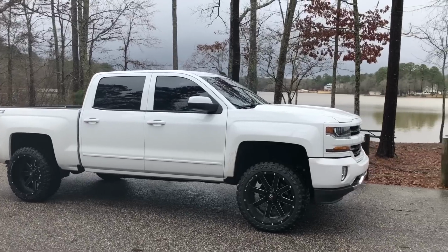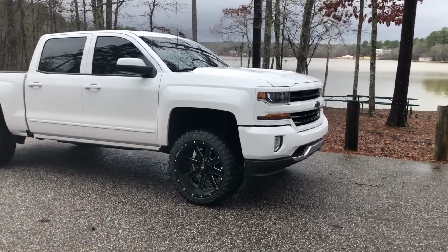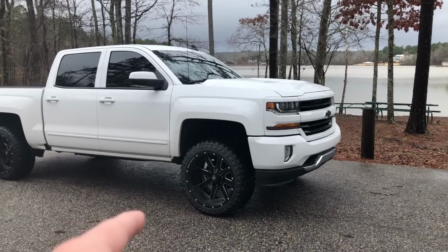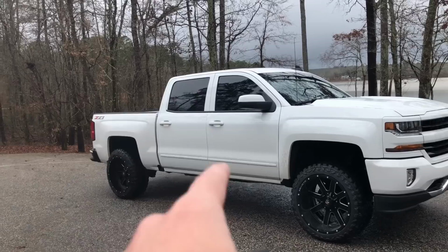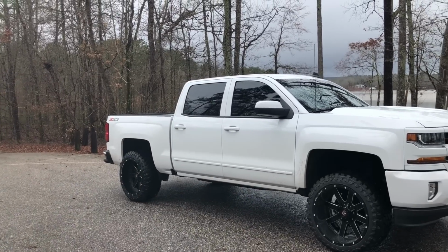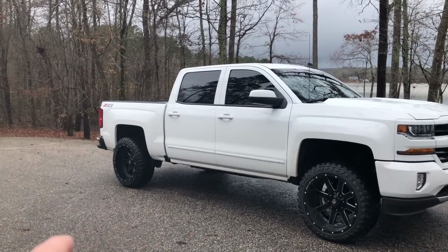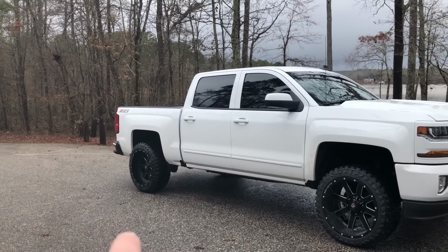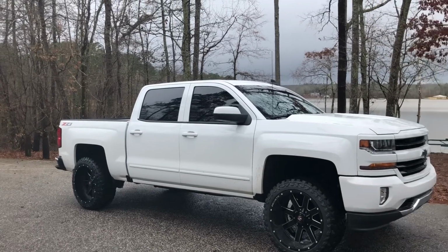And that definitely tends to make your truck more choppy. Obviously you have unequal length exhaust because your driver's side has got to come all the way over to the passenger side and then go back, and then it's got to go over to the driver's side exit. So your driver's side exhaust is a good bit longer than your passenger. I guess you could flip them at the end technically. No one ever does that, but I guess you could flip them at the end to where the passenger goes to the driver, and that would somewhat equal them out.